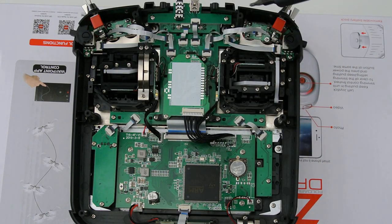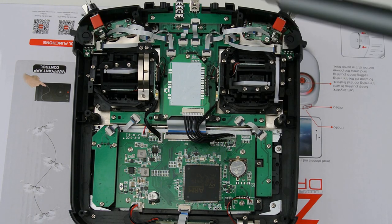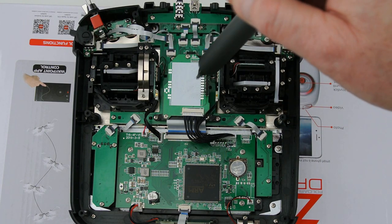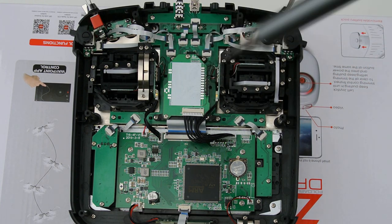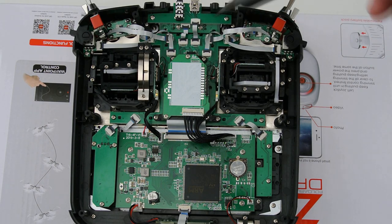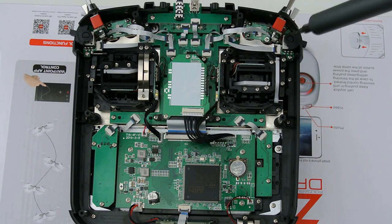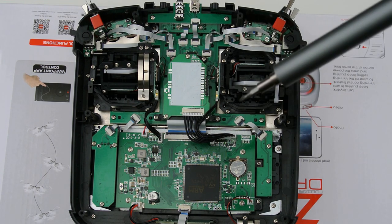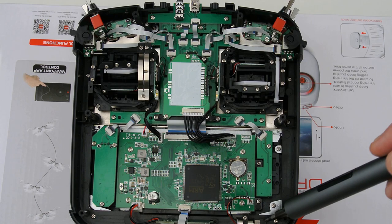The finish is really nice inside. It's easy to get the outer cover off — there are six screws on the sides plus two allen screws in the top, and that's all you have to do. I'm really impressed with the fit and finish inside. You can see where an internal module would go — there's a module board but no actual module on it, and those are the pins that go into the four-in-one on the back. It's all modular and everything comes off. To remove the side pieces there are just two screws on either side and they lift out. Just be careful because they're on ribbon connectors — won't necessarily damage them but make sure you put them back in properly.